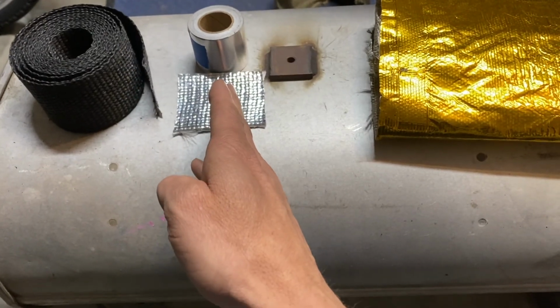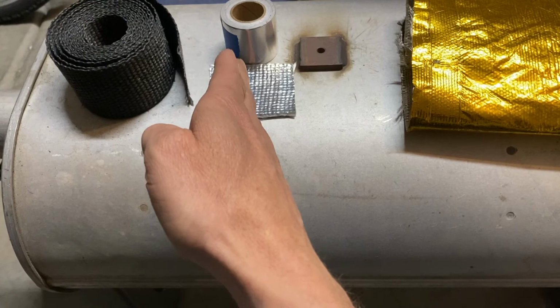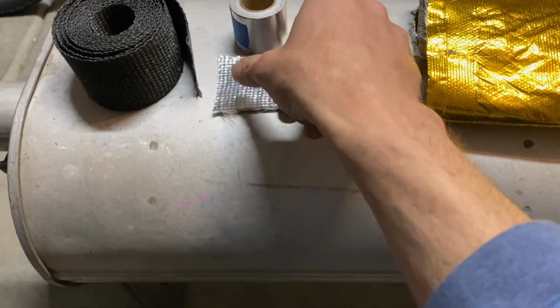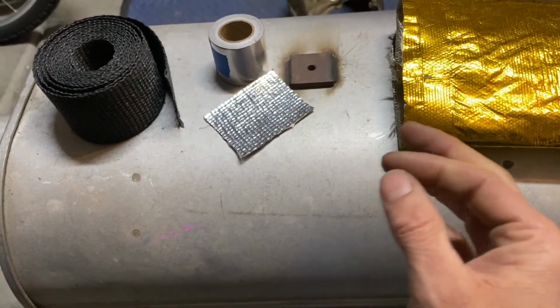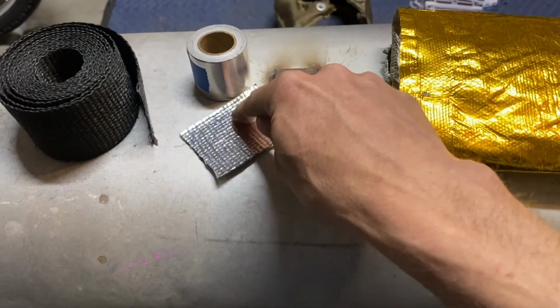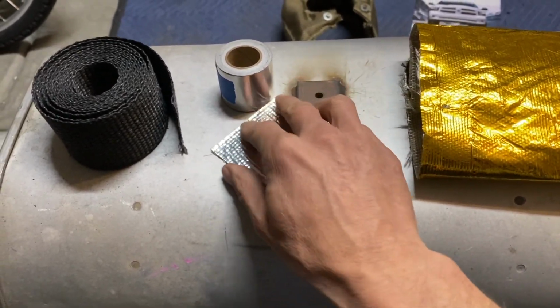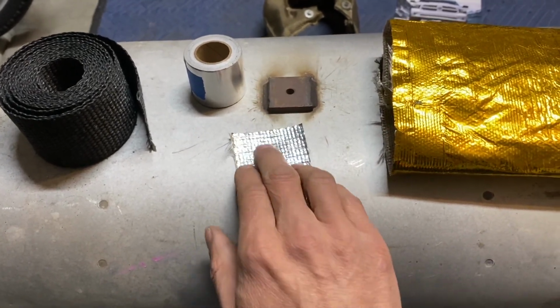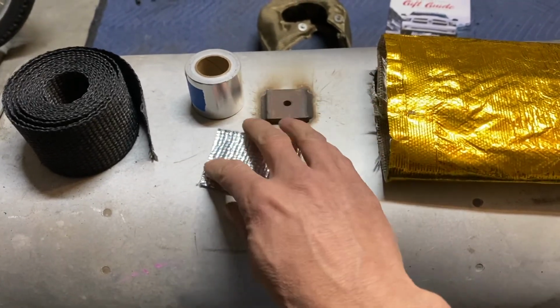Oh yeah, baby. So just a real simple video of why I'm using this. You see where this is at. I'm only using it on one piece of pipe, and that's the one with the hot dam. That's to keep a little bit of heat off. If rocks or anything kick up and hit this, it's soft. It won't make a loud ting sound. And the sun isn't going to get through this, or at least I don't believe it will. This will deflect the sunlight.